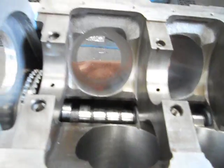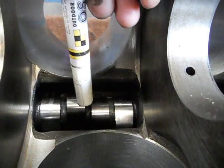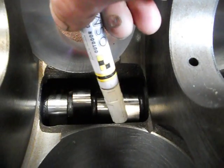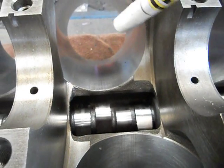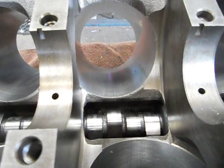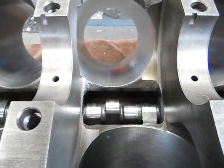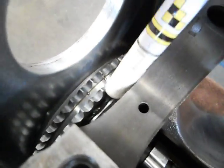Also on hydraulics and solid camshafts, on your profile, they're actually tapered across here. Across the nose, your camshaft has got a taper. And on your lifter it's got a slight radius, which makes the lifter turn and spin so the lifters don't wear out. That also pushes the camshaft back to its cam gear on your thrust.